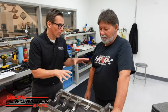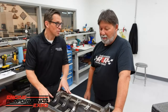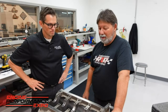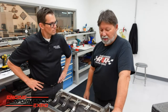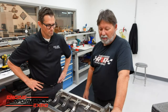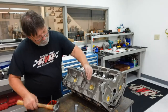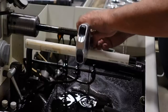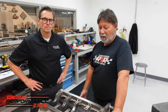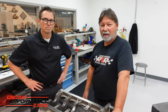It's getting a little bit closer. All the block work that's been done by Chris Straub and his guys, now it's here. It's time to put together the short block. We've already fit all our bearings on the mains, washed and polished our crank, and Randy Neal balanced the crank. We've got our bearings in, got all our clearances written down and checked. Camshaft bearings are already in it, plugs are already in it. Everything's final washed. Rods and pistons are on the table. They're done.